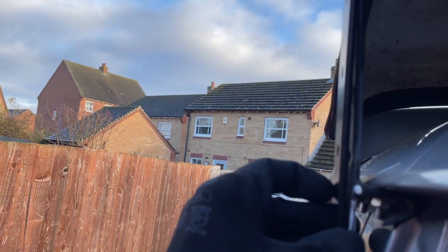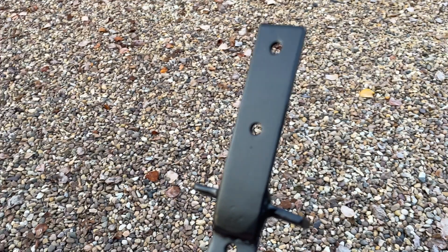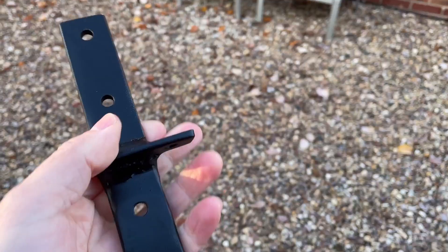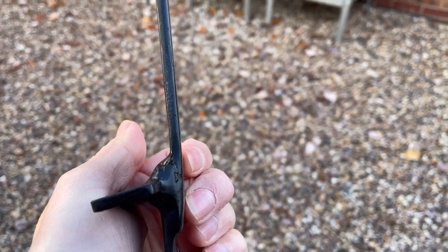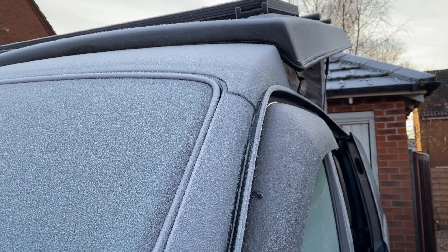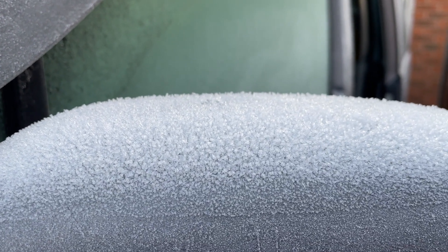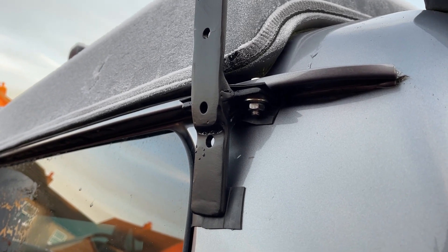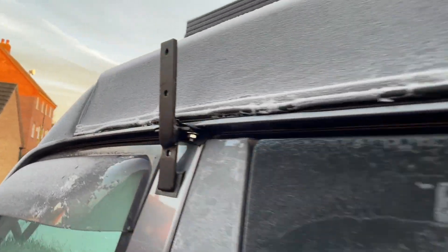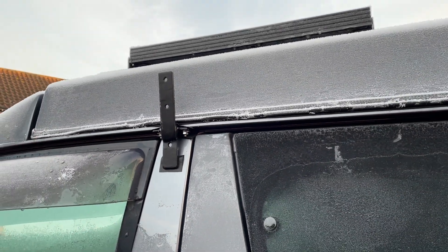I need to come out just a little bit further, so I'm going to chop the top of the bracket off and re-weld it a bit further down. I've chopped off the top, moved it down, stepped it out, given it an angle, and put tons of weld on it so it should be pretty strong. I've sprayed it again — fingers crossed this is the one. I've saved all this work for the coldest day since records began. It's been one of the reasons I've been going slowly — too cold. But finally the brackets are on.